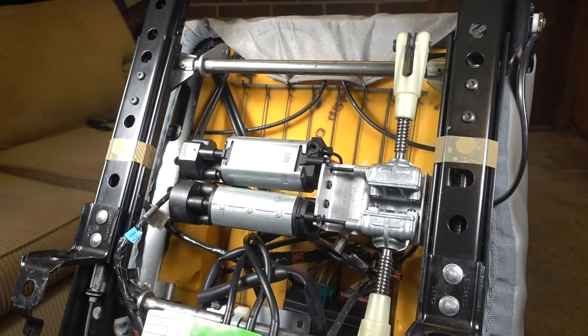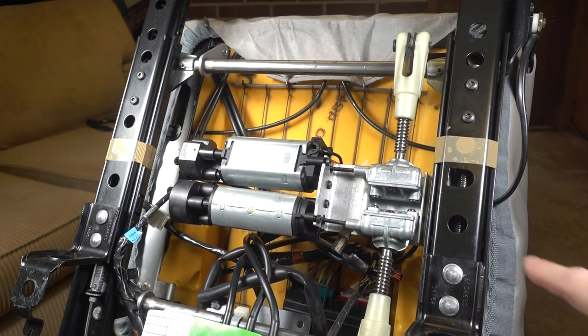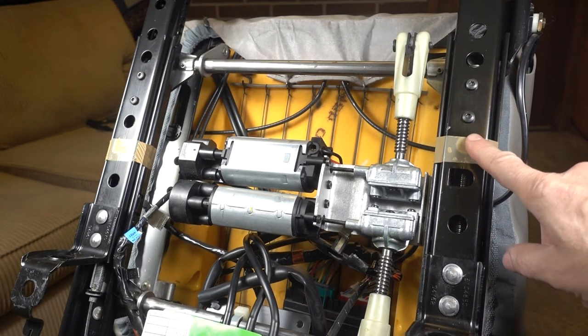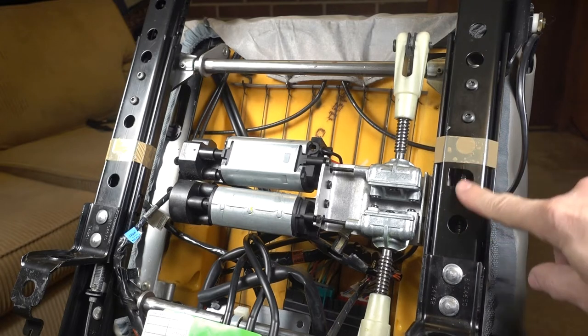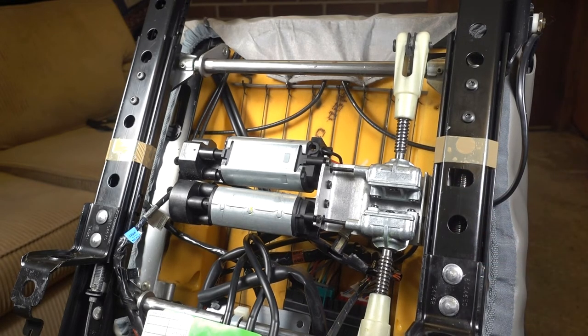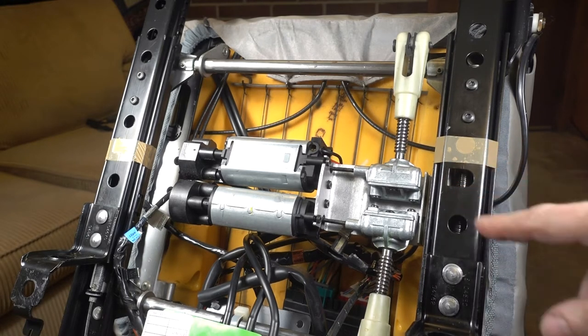Here is some bonus footage. Now that I've done three rails I have a lot more experience and some tips that might be useful. This is the second seat, the driver's seat. I've decided to use tape for indexing to keep it whole — I did not slit it. I found that I don't need to slide the rail to get the threaded shaft in place, and it also helps hold it up and keeps it from sliding in the way. So I don't recommend slitting the tape — leave it whole.